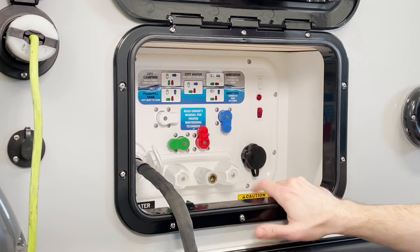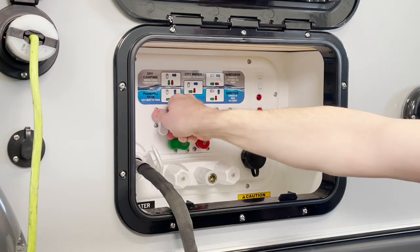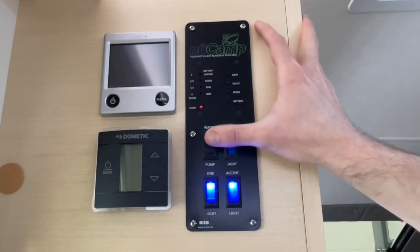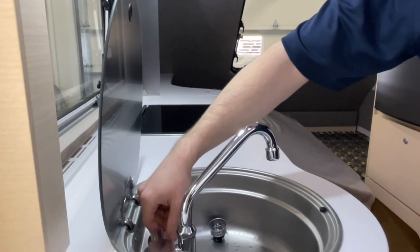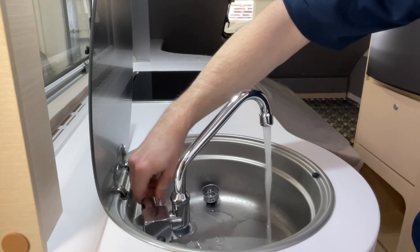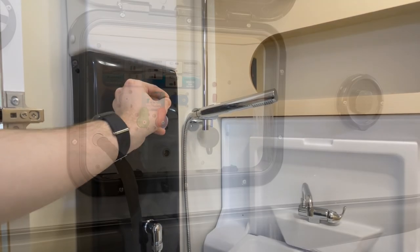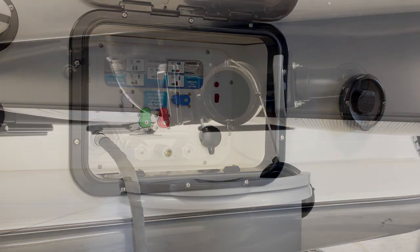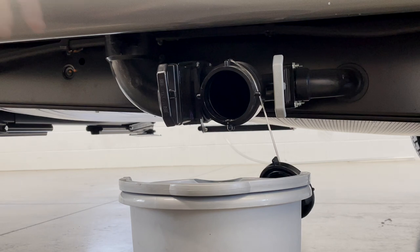Put the Nautilus panel in dry camping mode according to the key on the sticker. On the inside of the camper, go ahead and turn on your water pump. Then we're going to run that sanitization fluid through all your faucets and fixtures. Also remember to hook up your external shower and run water through this as well. Once you've run all your sanitizing fluid through your faucets and fixtures, it's going to be in your gray tank, so you can go ahead and empty that again.